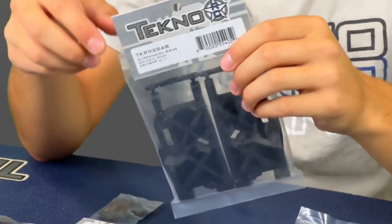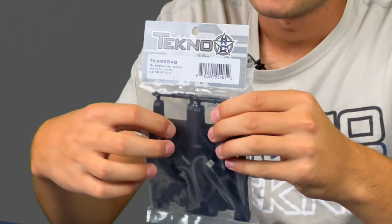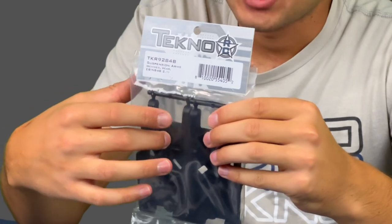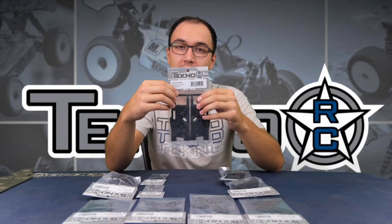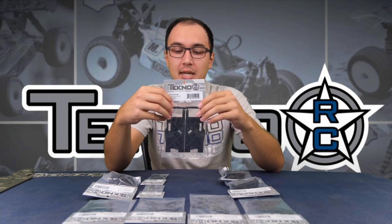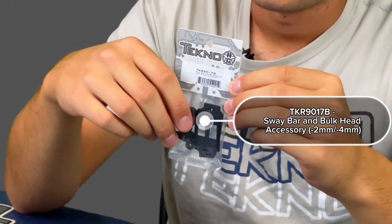When you use the rear hubs, a part you'll need is the revised rear suspension arms. They have some cutouts for the driveshaft to give a little more clearance. You don't need to use these — you can just Dremel the standard arms, being careful to make sure the driveshaft isn't hitting, especially where the universal is and in the center. But for ease of use, we revised the rear arms so they just bolt right up with the rear hubs and gearbox, and you don't have to worry about any sanding or Dremeling.